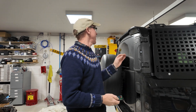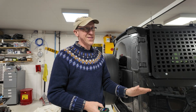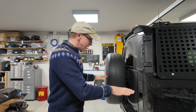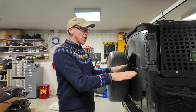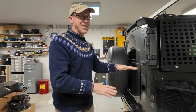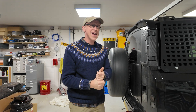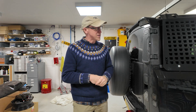So that is our base reading, and the tyre pressures are 36 PSI, giving us our first point on the graph. Now what I'm worried about — because we have to think about these things — is if I start letting the tyre pressures down, will the car decide it's going squiffy and try and adjust itself? So we are going to disconnect the battery so the car is absolutely brain dead and can't adjust anything, because with the battery disconnected everything's fixed.